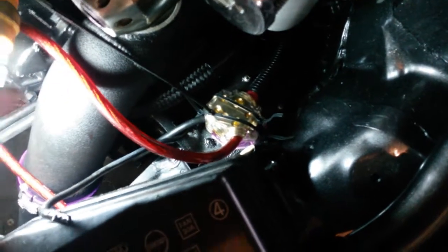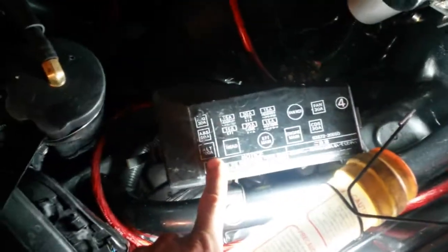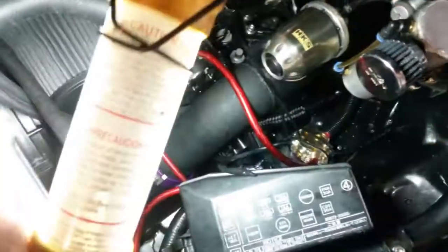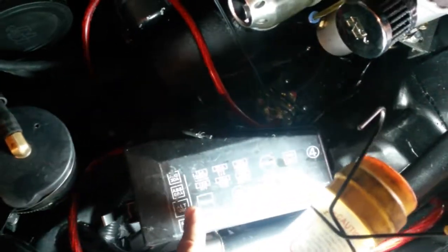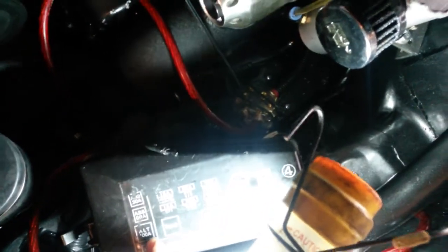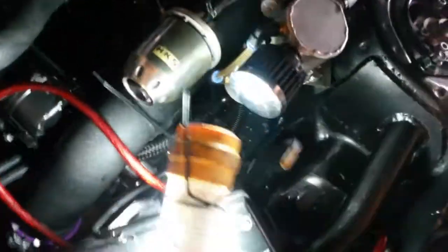Before, I had this hooked up with two on the alternator terminal and this red wire there, but now I just ran this red wire into the alt fuse on both sides. So now, instead of having the factory wire, I have a four-gauge coming to the alt fuse — one wire goes here, the other side goes to that. I still run the 100-amp alt fuse like factory, but I just replaced all the factory wire with four-gauge. I'm going to test it out here in a second.